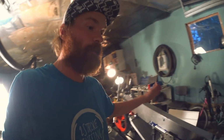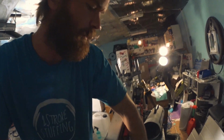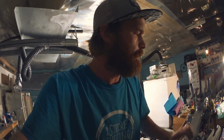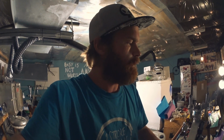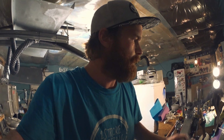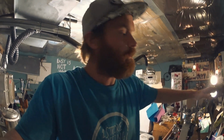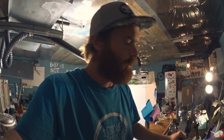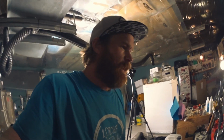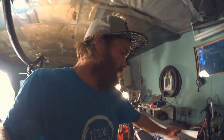So it lost fuel, and that could probably have led to it seizing, because I was monitoring the EGT and I was playing with the carb to lower it. It was rising rapidly, getting close to 1200, and I started richening it up because I was still at relatively low RPM and was actually going to try a run. But then suddenly it just jumped to almost 1300 Fahrenheit and the engine stopped, and I thought, that's it. But it wasn't. It was the fuel that was completely shut off. Okay, to get to it.